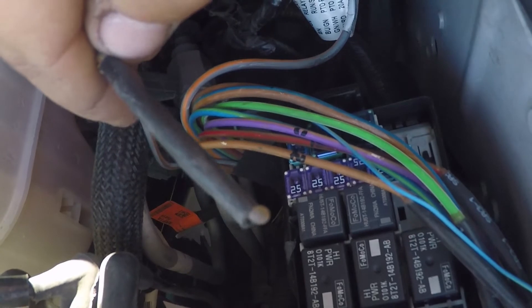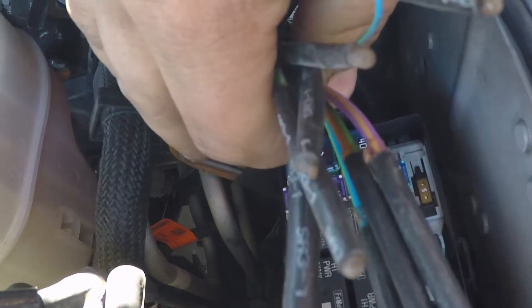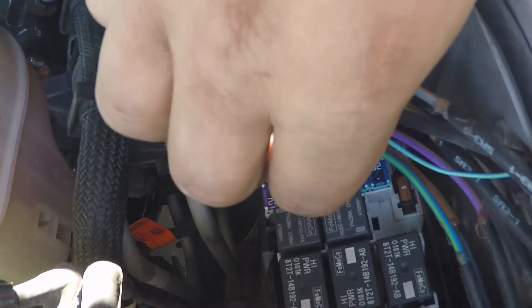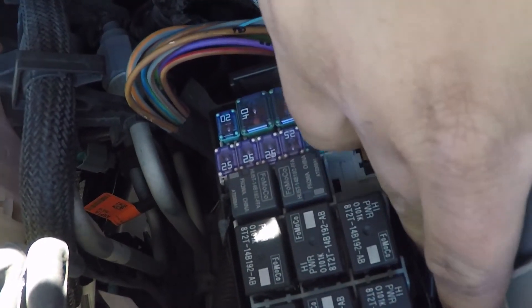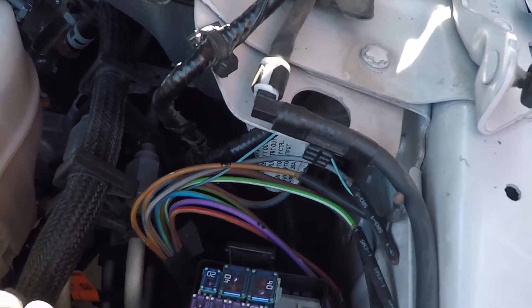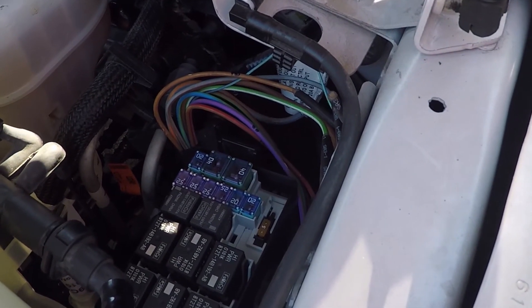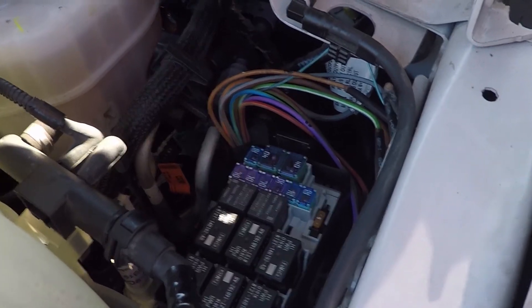One wire is already being used from something I just installed. There's your bundle of wires — there's a label on the gray and orange one telling you what each one is, and it's also in the SVE bulletin from Ford. They're all labeled and blunt cut, sealed off, so all you have to do is strip it back and connect into them. This is where the power comes from for your switch — say you have work lights on the back, just run a wire down your frame to the lights and connect it here, hit a switch, and they'll come on if grounded and installed properly.